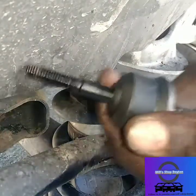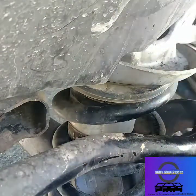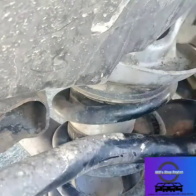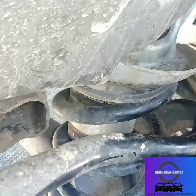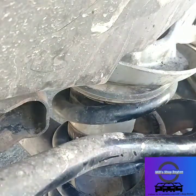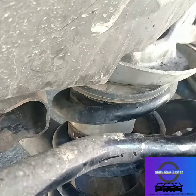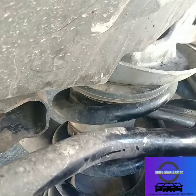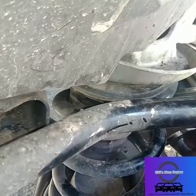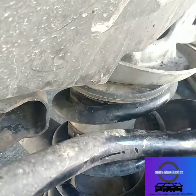Back with the new sway bar link — always compare your parts. I stripped off the top and the bottom sway bar link and I'm gonna try to feed it in the exact same way that I took it out. I'm gonna feed it down here, holding the bushing on, into that hole, and then take my breaker bar and get that between the shock — a good leverage point. The higher I go, the better and easier it is. Up and in.